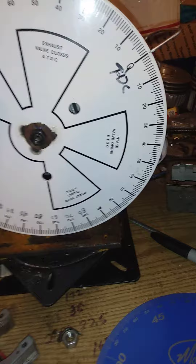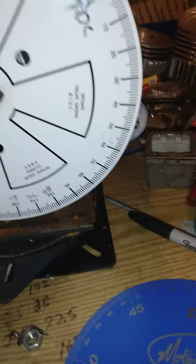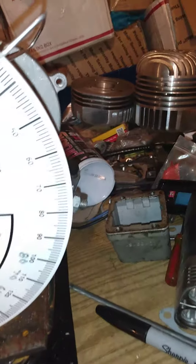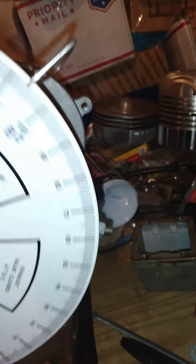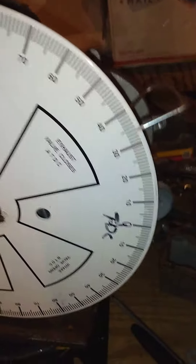It's critical that I set up a motor for degreeing only. When I set my motor, I always check to see if it's true TDC. This isn't race cars, but like I said, you want your wheel to be super tight and you want it to stop at the same place going in different directions — which it does now.